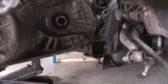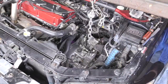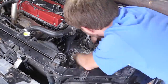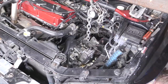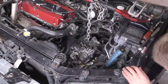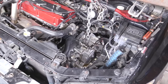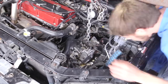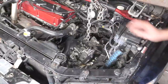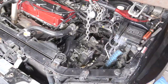Little by little, I jacked this up in place and moved it around. My shifter linkage did end up getting caught a little bit where that motor mount goes — the one on the driver's side of the car, the top one. The shifter linkage got caught up in there on my first attempt. So it was just lifting up wrong in the wrong spot. I wish I could tell you exactly how you need to do it, but there is no secret key to this. You just might have to try it again.